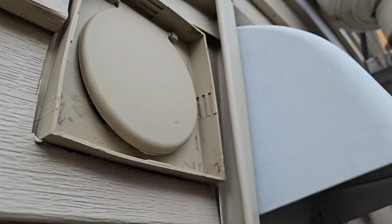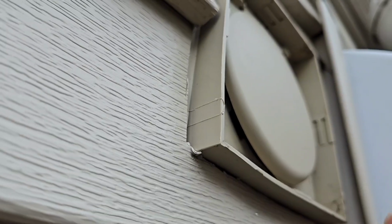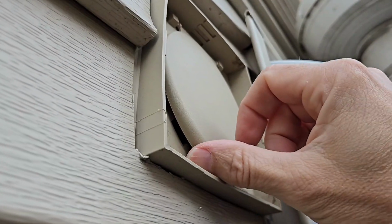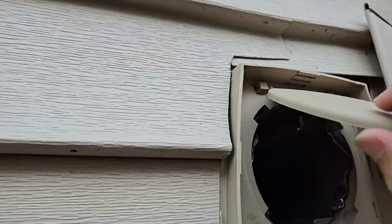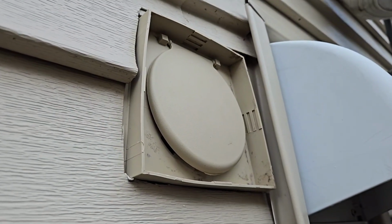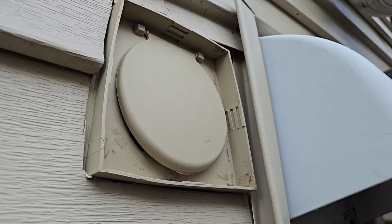When I moved the dryer away from the wall and disconnected it from the dryer vent, the water from the condensation caused a puddle under the dryer vent. So that's how high the humidity outside was. The siding company did come out and fix the dryer vent issue. So now air isn't being drawn in from the outside when the dryer isn't running, and that eliminates the condensation problem. But now let's go back and investigate why the dryer didn't heat.